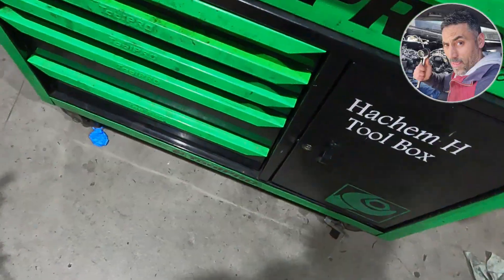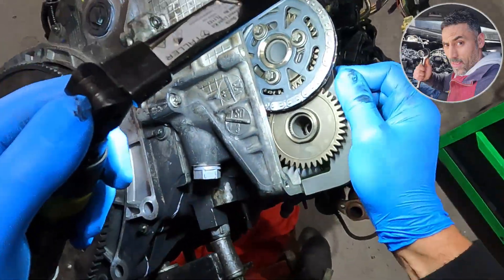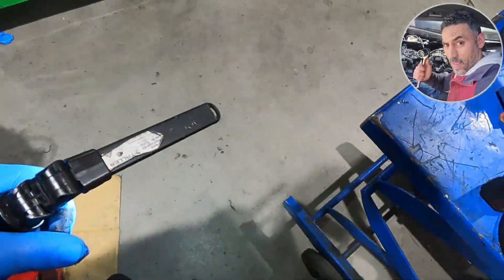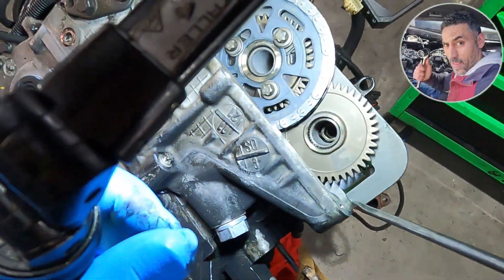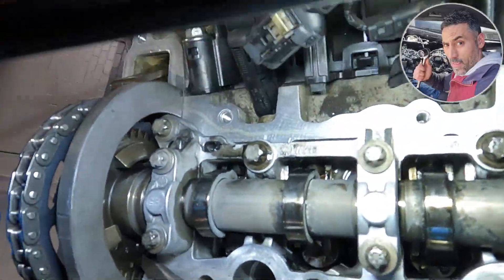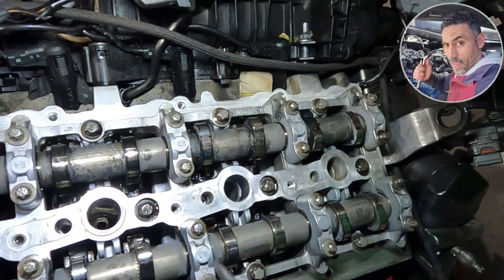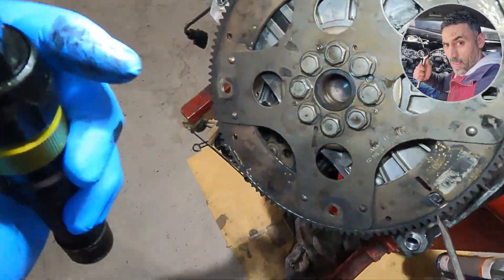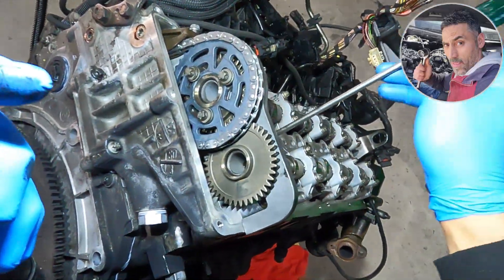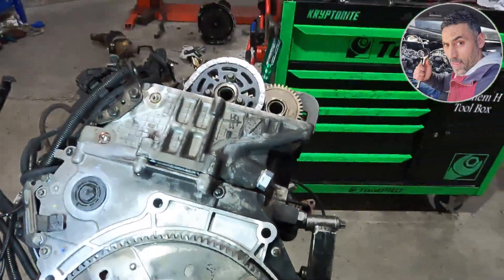On the camshaft I have to see the three dots in the front of the gear and the back together. The timing holder for the cam must be touching the cylinder head, and I have to see the camshaft part number and the puck code on top. That's it — the pin is in place, all good. Cylinder number one is all the way up. The timing is set 100%, inshallah.